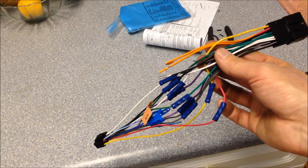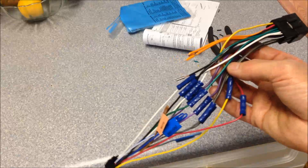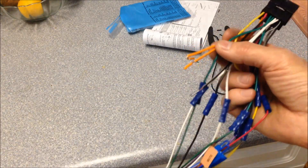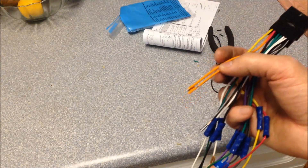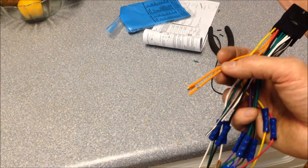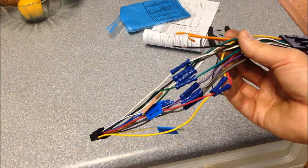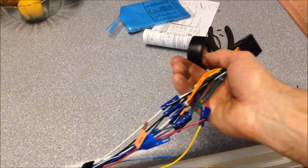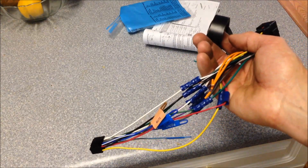You can see I've got the wire harness all put together, and for the most part it was an exact color-to-color match on all wires. There are only two additional wires here — these are for the illumination for your radio, and since that's internal to the Kenwood stereo, it doesn't really need that. So I'm just going to black-tape these up, wrap them up a little bit, and for the most part this part is done. Pretty straightforward.